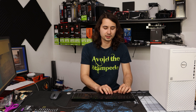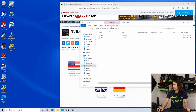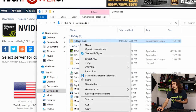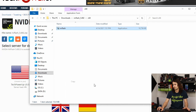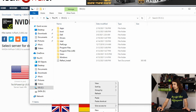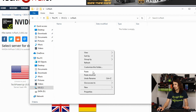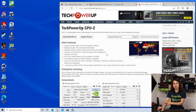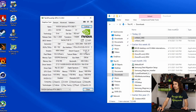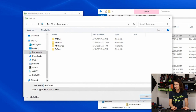First things first, we're going to download the NVFlash tool. Go to TechPowerUp — I'll have the links in the description — and download NVFlash. It comes as a compressed folder, so extract it, go into the x64 folder, and copy that application. Then go to your OS drive, create a new folder named NVFlash, and place that application inside. Then download GPU-Z, open it up, and extract your factory BIOS. I named the factory BIOS GA104 Dell because it's short and easy to remember.